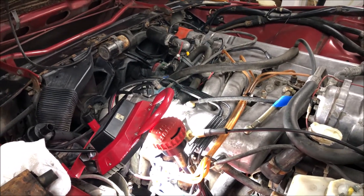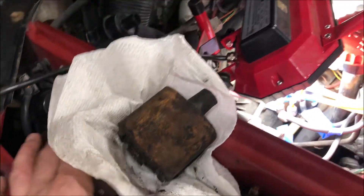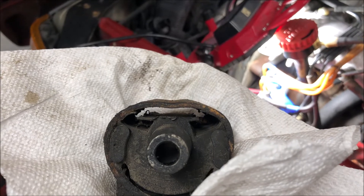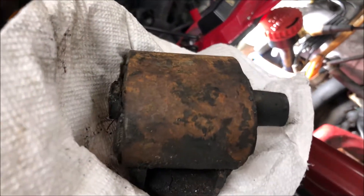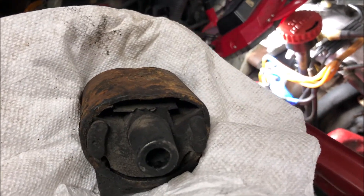Hello viewers, I just wanted to put together a quick video that might help some people out. This repair is replacing the motor mount on the driver's side, the rear of the engine. This is the one I just replaced from the car — it's all sagged. This piece of rubber at the top would have met, or at least it did on the new mount. So this is pretty sagged; I guess it's original to the car, but at any rate it's in tough shape. I decided to put a new one in.